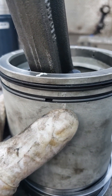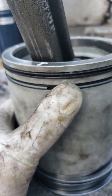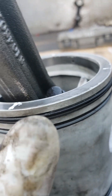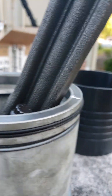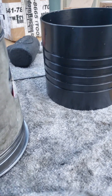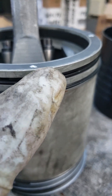I've made marks where the oil rings are. I first put this one in, pushed the piston and the oil rings all the way in, so there's no chance of an overlap. Then I went and put the second one on. You'll notice it's bulging out more, and the reason is because that oil ring is on this side, and this side is pushed in all the way.